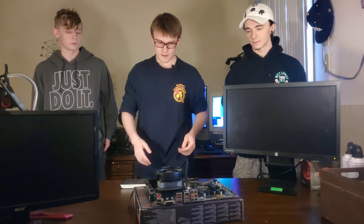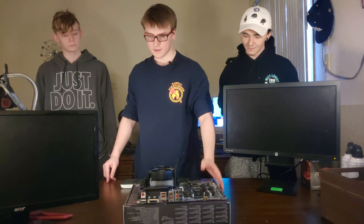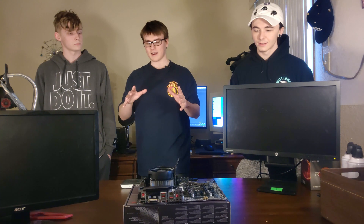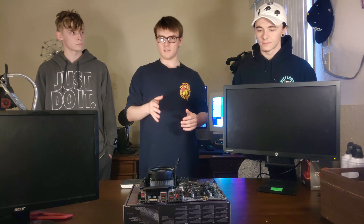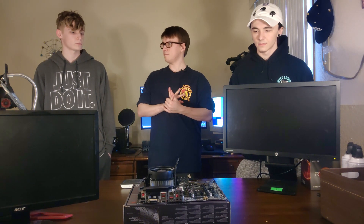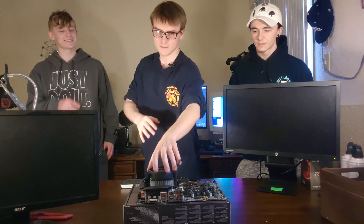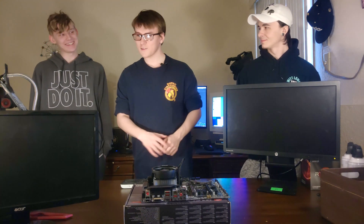Is it an X variant? No, it's not. They're all overclockable — there's no real reason to get the X version. The first thing we have to do is verify that the BIOS is actually incorrect. It won't post right now even with a GPU in the system, because Austin did try the onboard. Did you use VGA or HDMI? DVI with an HDMI adapter. This monitor uses that exact same thing — convenient.